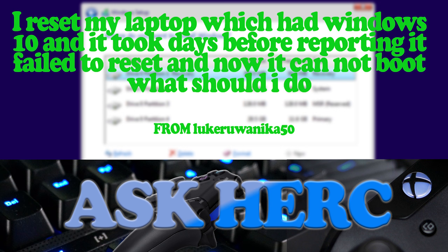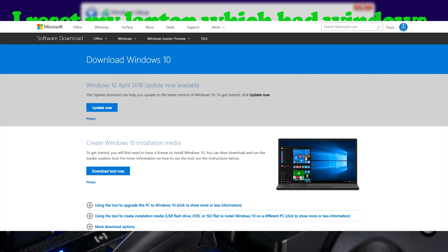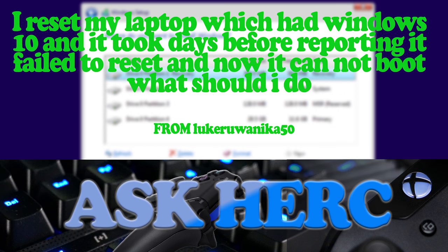If you're using the OEM partition and don't care about bloatware, go for it — Windows 10 bloatware can be removed in about five to ten minutes anyway. Get on another computer — at your library or a friend's — grab an 8GB thumb drive, which are dirt cheap, and download the Windows Media Creation Tool. Google it and the first link takes you right to the page. Download it, run it, let it do its thing. Boot from the thumb drive, delete all partitions, and do a clean install. Good luck — hope the force is with you.